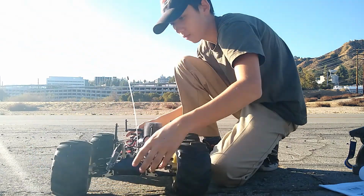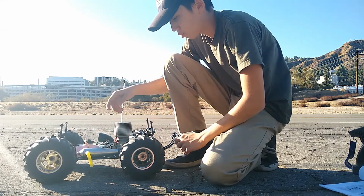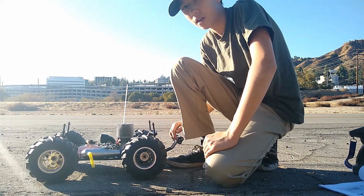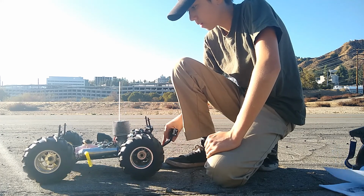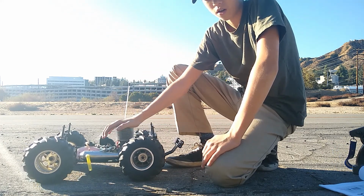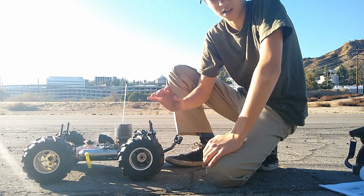He also gave me this body mount, as mine was missing one. I'm running VP2020 mix on this thing. You have to use helicopter fuel because it's a ringed engine and it just needs more lubrication. I was able to get it started for like 1 second yesterday, and then I just didn't mess with it. I'm not gonna really count that as a start.